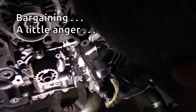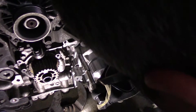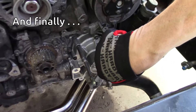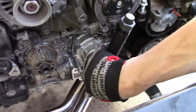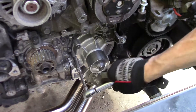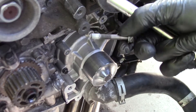109 inch-pounds — that's a little much for a six millimeter thread into aluminum. Subaru's torque specs on this water pump are really too tight. So this one right here won't go past 20 inch-pounds. This one right here is stripped out. And this one right here below it is also stripped out. It just keeps on turning. So those two, I'll have to get a Time-Sert for. I have to take out this water pump again for the thread repair. Next time, we won't torque the bolts so tight, even though the spec... Yeah, look at that. That's not good at all.